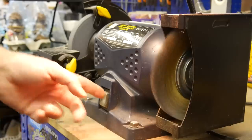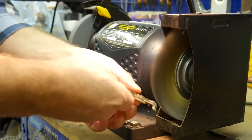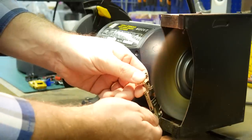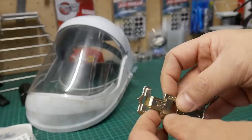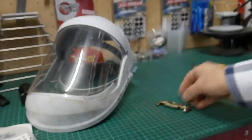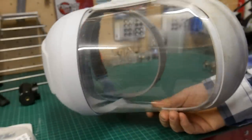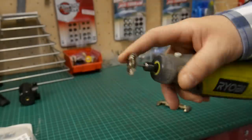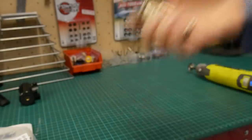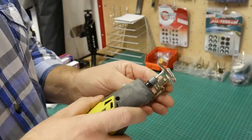I'm going to start a couple of different processes to get the body and chassis back to their glory, starting with the wire wheel — only on the chassis at this stage. I get the heavier particles off there and then swap over to a smaller wire wheel on a rotary tool. I always use the bigger face mask for this rather than little goggles, because the little wire bristles that fly out of these wheels are very very sharp. I'll lightly go over the bits the bigger wire wheel couldn't reach — only takes about five minutes.